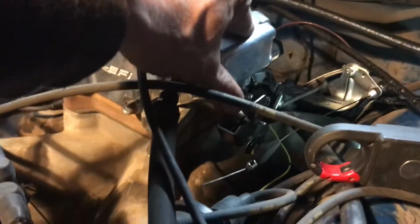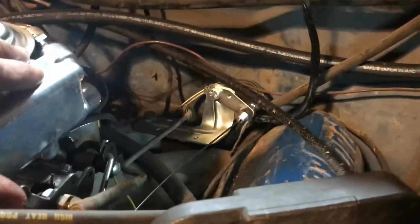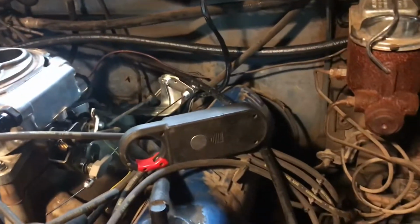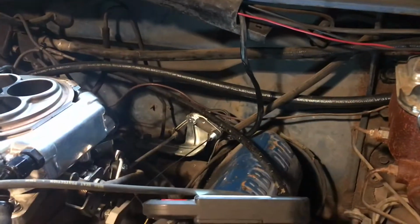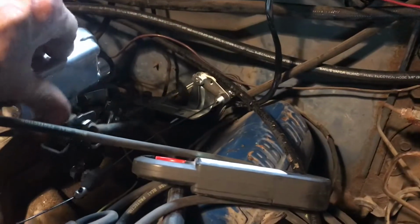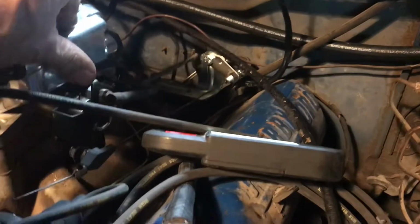Kick down. Put the little bracket, mounted that to there. I never cut the cable because I'm not going to shorten this. I'm going to keep that. And so I never had to cut the housing. I just let it loop back around and back up, and it's just laying on top of the transmission. It's not hurting anything. You can tell this kicks in about half throttle.